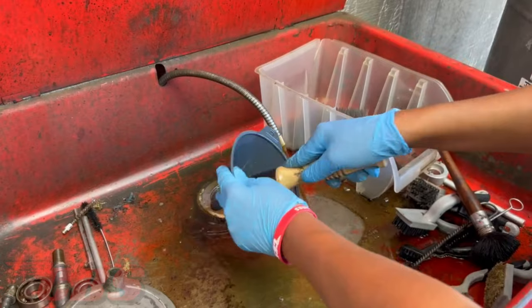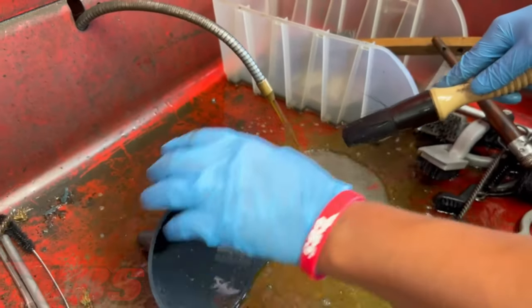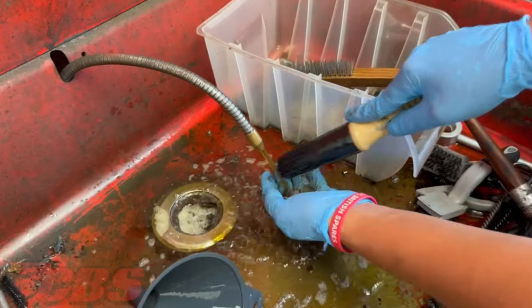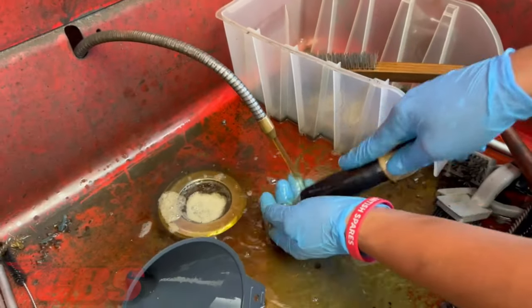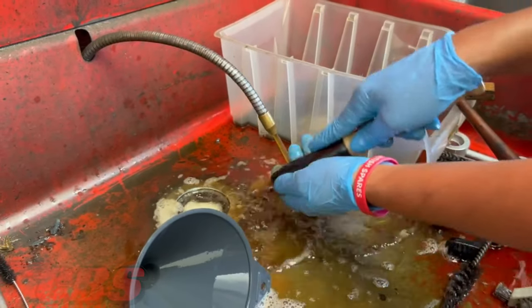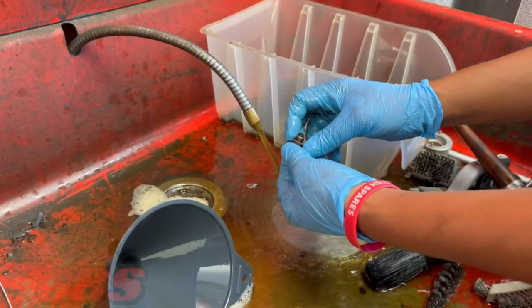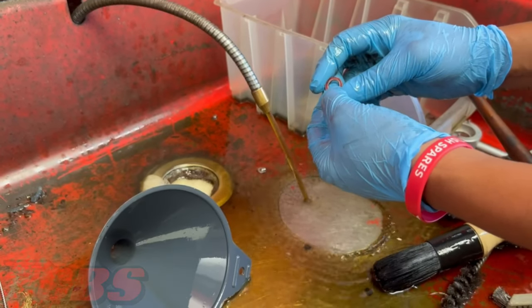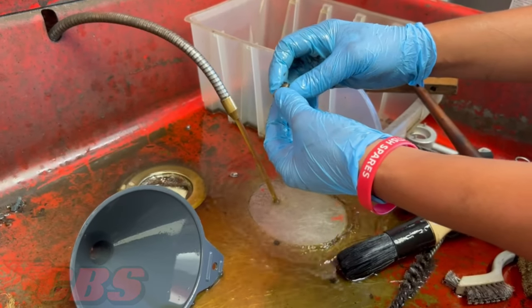I'm just going to clean the funnel off here, get all the old oil out. We've got the magnetic drain plug here — very little fuzz buildup, so everything looks fine. No particles, no chunks — looking really good. So now that we've got this clean, we're going to clean some of this Yamabon that I put on the fiber washers. Sometimes the fiber washer isn't really good enough to have an adequate seal, so I usually put some Yamabon around the fiber washer and then install it into the oil tank. We're going to head back to the shop, put the plug back in the oil tank, fill the tank up with oil, and go from there.